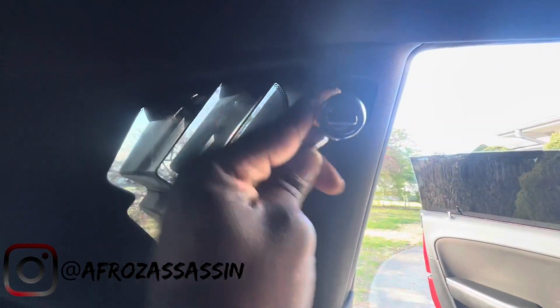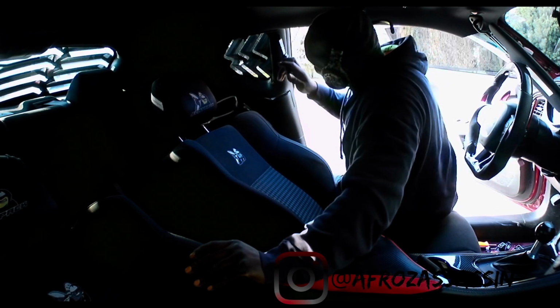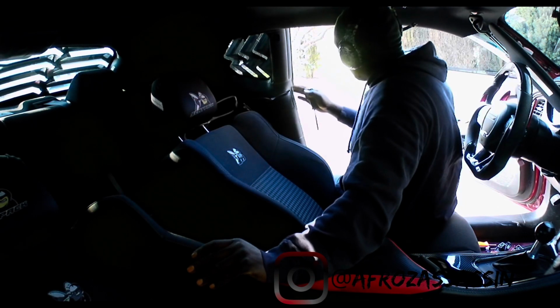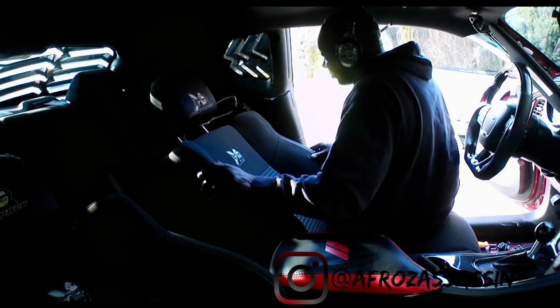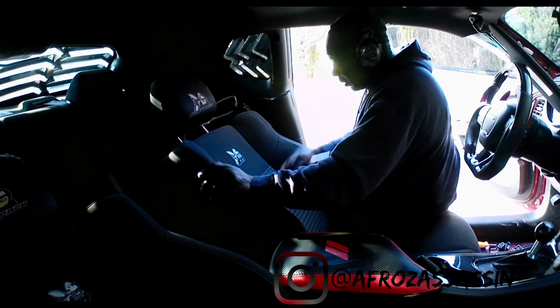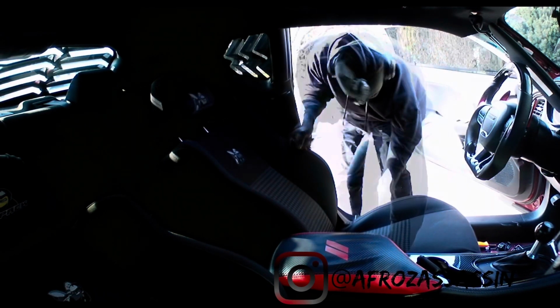Indeed a 7, and I'm going to crank that out, and just repeat the process. I'll pick up video when I'm popping this whole entire B and C panel off. But after I remove this 7mm bolt and that 7mm bolt, there's actually one more screw directly behind here, and it's just a Phillips. So I see why some people do remove the seats when they're doing this. I'm simply going to pull this forward and work that way.